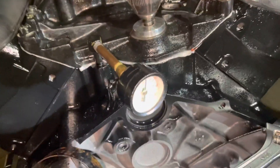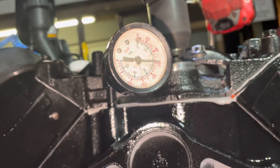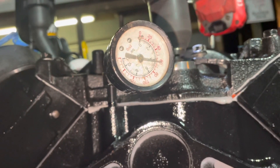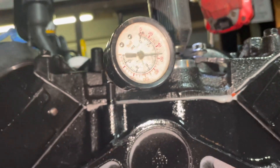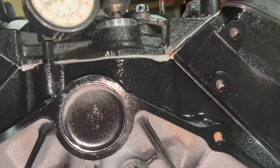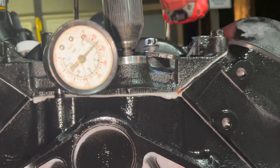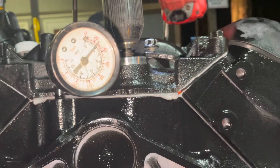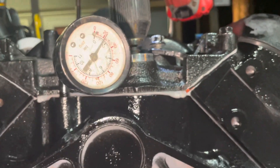So let's see what we got. If I crank this drill, it'll drop back down. Now that I've got oil pressure, I'm going to hook up a battery to the starter motor and turn this motor over. I'm going to rotate the engine just to make sure that all the bearings and everything get plenty of oil pressure and turn.